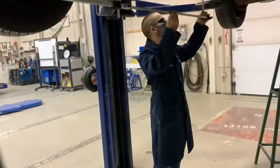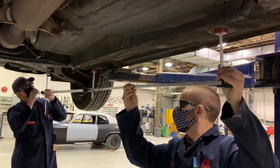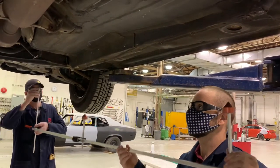Here we are placing the gauge on the vehicle. If the pointers fit in the holes, then we are good. If not, we will have a visual indication of any height misalignment and/or length or width misalignment on the vehicle. We can then measure and record those dimensions on our sheet. As we transition into parallel data measurements, this is a good time to check your equipment for damage as seen here — those will give you false readings.